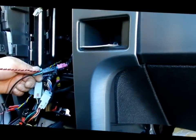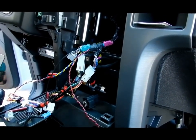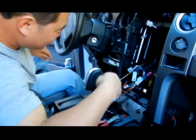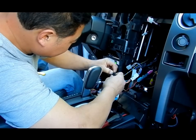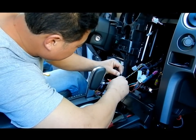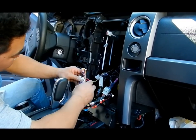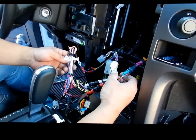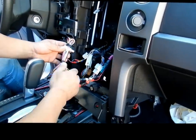I think I have chassis ground at best. RCAs plug back into each other. It says the RCAs plug back into themselves unless you're using a rear seat entertainment system — it has pass-through. So that's output three right here, the white with purple, which gets that red wire from the navigation antenna. Might want to get some bullet connectors because they plug right in.